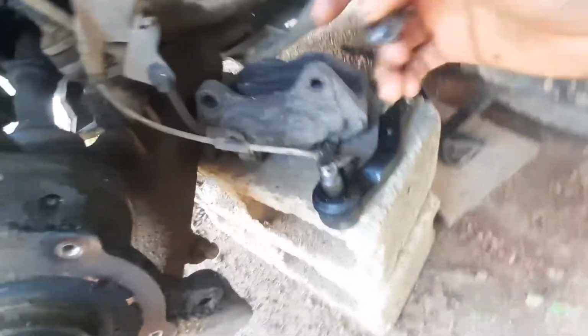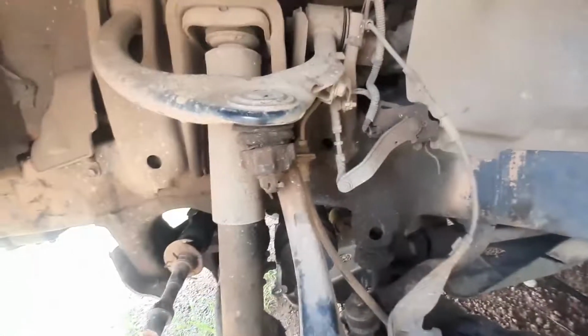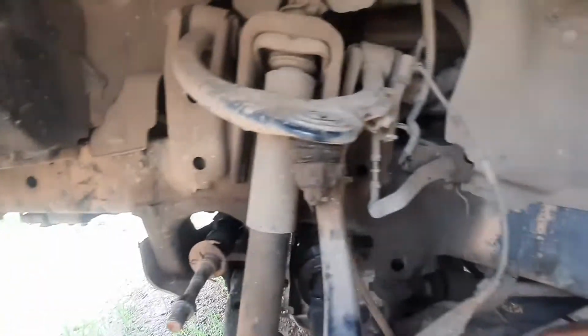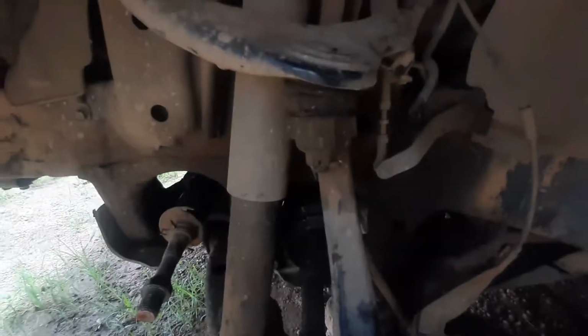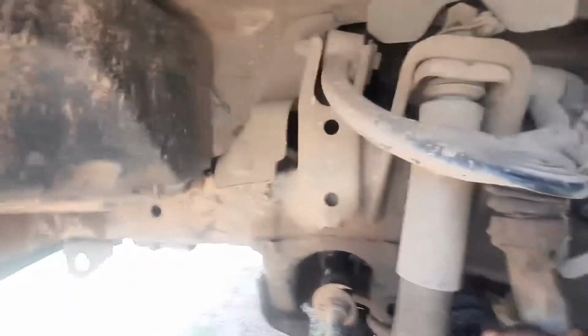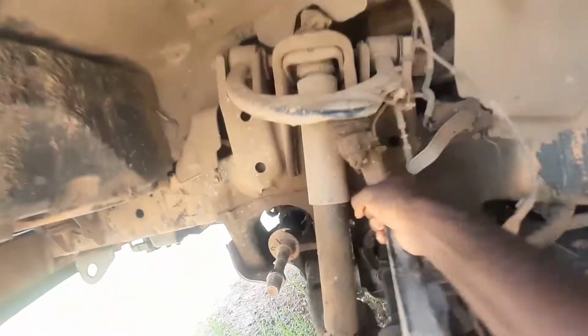So we're gonna have to change the nut, and we were gonna change the tie rod anyways, but now we're just gonna have to change it even more. So the next thing is to get goggles and my gloves and take off this upper ball joint. It's just the cotter pin. Then we take off the castle nut. Should come off fairly easily, and then the load from the spindle and the lower control arm and everything should just explode this out of here, and it shouldn't be a big deal. And then we can just pull the spindle down and out.